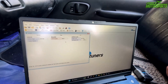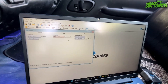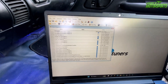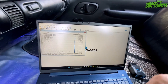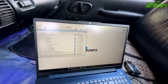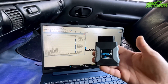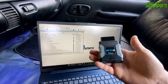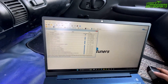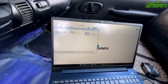With the MPVI2 — this is before the EPA got involved — you could go in and turn off the rear O2 sensor check engine light. This is for off-road vehicles, track vehicles, farm use, or LS swaps not driven on the highway. They have that setting, and you can do the same thing with the MPVI3, but you have to take a course online before doing any of that. The MPVI2 is grandfathered in so it doesn't have to do that.